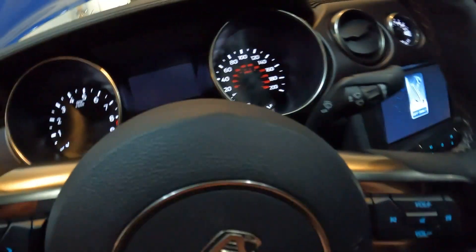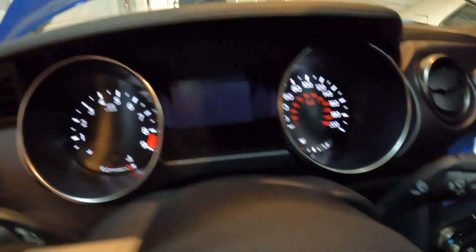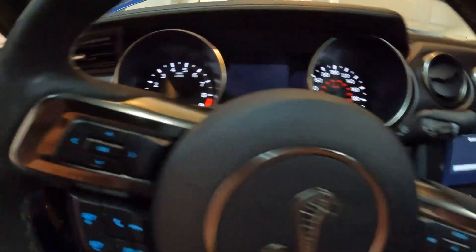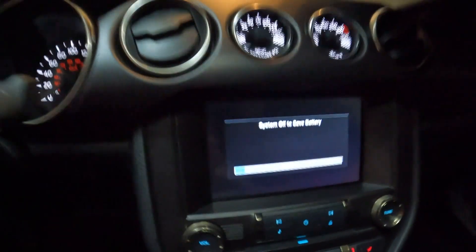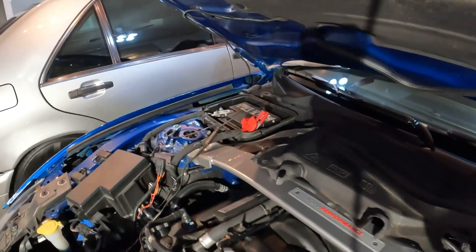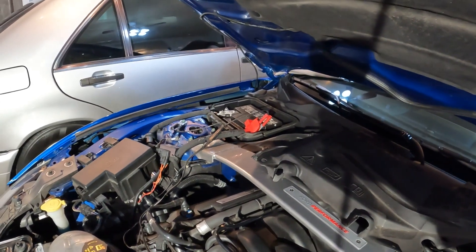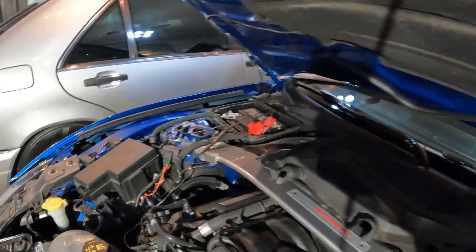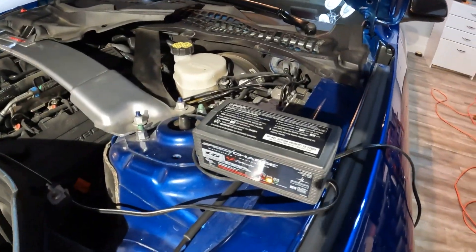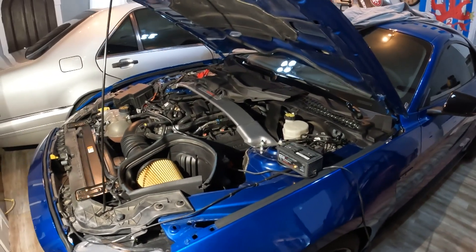Let's check the mileage — I'm embarrassed, I don't have many miles at all. The system is a little slow booting up today. I'll get the trickle charger hooked up instead of wasting time. You put the positive red clamp on the positive terminal of the battery and the black one on the negative — meaning on the body or chassis of the car. Then the trickle charger goes into charging mode, indicated by an orange amber light, showing it's charging the battery.